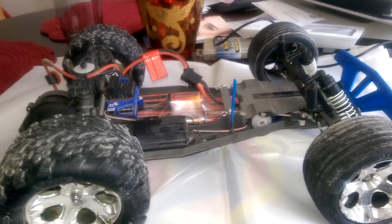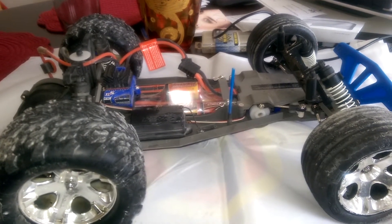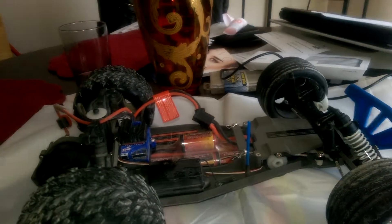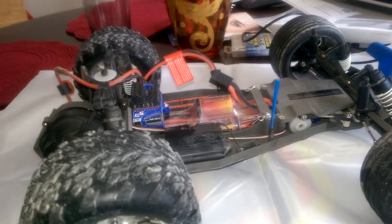What up YouTube, it's your boy Chevy Brother again coming at you from the Chi with another update video. I took the bucket of bolts out — old F-Bomb — and I finally hit my 30 mile an hour mark. Look at the GPS, y'all: 30.19. The setup I used to do that was a 28 tooth pinion gear, 83 tooth spur.